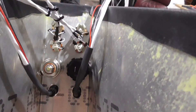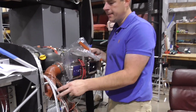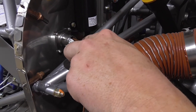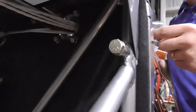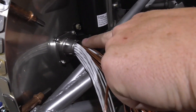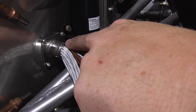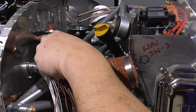Come over here and I want to show you the pass-through. This is a firewall pass-through. I wanted to do a mil-spec bulkhead connector, but because of this frame being in the way there was really no place to put it. Josh at Project Two Arrow used a bulkhead connector, and the new RANS kits have actually moved this to where you can use one — it's out of the way. But I couldn't do that here because of this embossment, which is concaved and not flat.